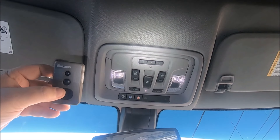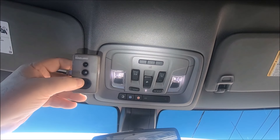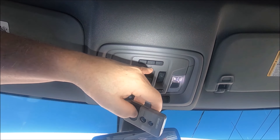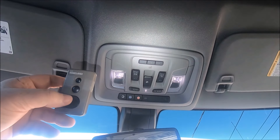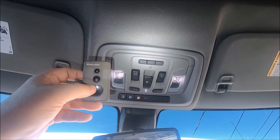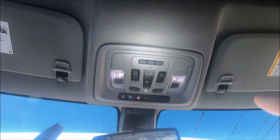What we're going to do is pick the garage door opener button we want to program. For this demonstration I'm going to pick the middle one, number two. Right here there's a little house icon with a little light in it, which is off right now. We're going to push that button and the garage door opener button simultaneously. The little light will blink real slow.